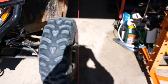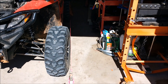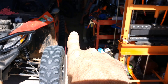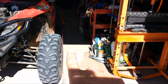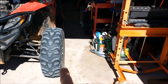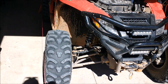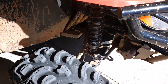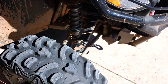And you can see how bad this is here. I have the string touching the back tire, just barely touching the back tire on both sides — front and rear of the back tire — right about centered at the axle center. And then the string comes up and just barely touches that front tire. So this one's way toed to the right and this one is the same way — you can see that big old gap back there. The steering box is centered, so I'm going to go replace the shaft and then we'll get this straightened up.